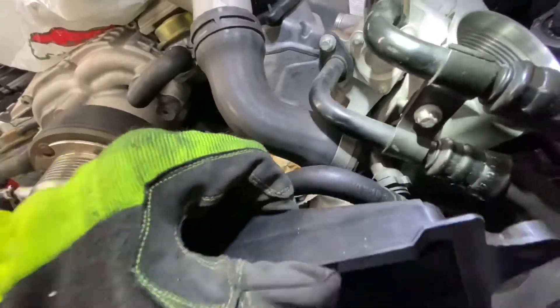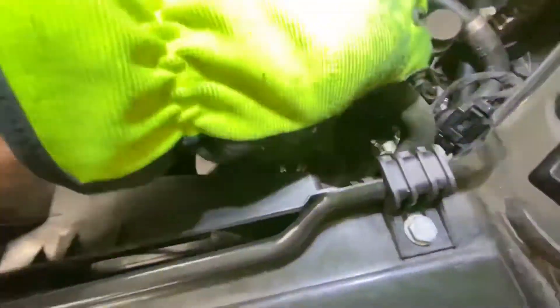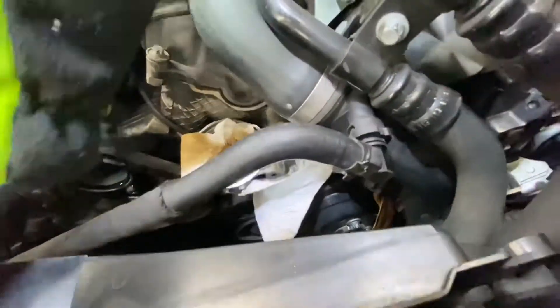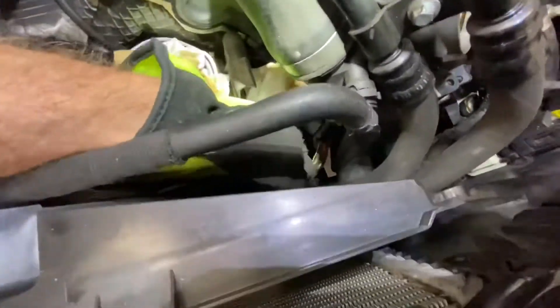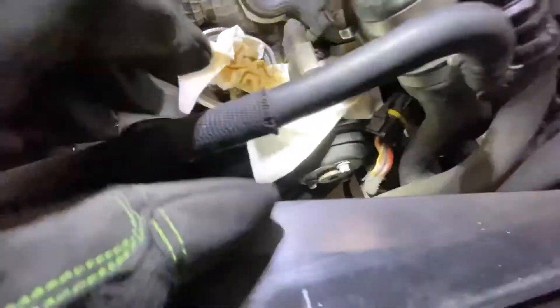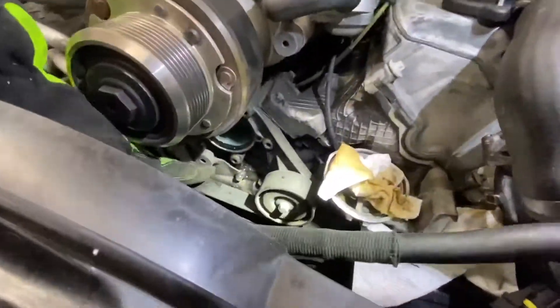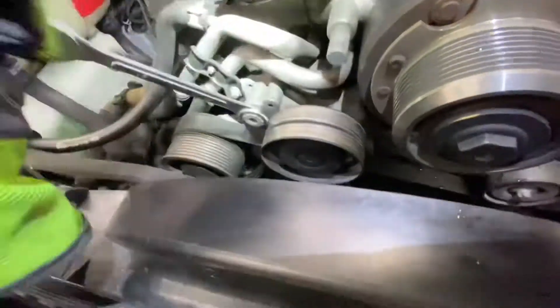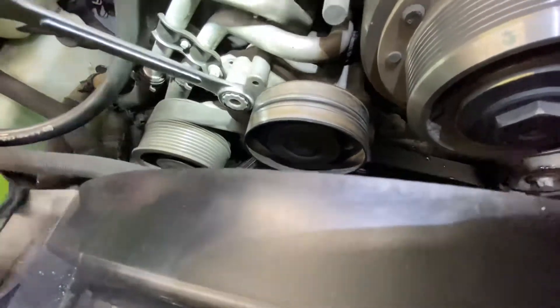I need to give myself some more space over here so I can get this electric fan out. I'm going to have to do a little more disassembly — I'll be taking this hose out here and hopefully get enough room to pull the electric fan out, because I need to expose the water pump and give myself space to work in here to remove the pulleys, belts, and generally service the whole thing.